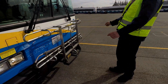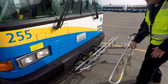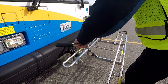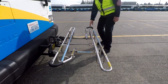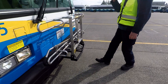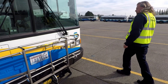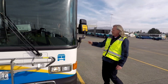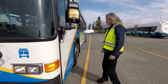We've got high beams, four-way flashers. Got our license plate. Also going to check our bike rack — locks in the down position. Pull these — that locks good. Put this back up. As we're coming around, looking at all of our lights, reflectors — everything looks good. Looking for any body damage. If we did find body damage, we would send that in on a TRAX message to comm center and let them know about that.